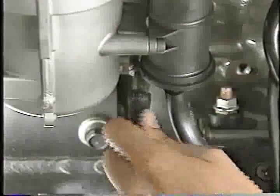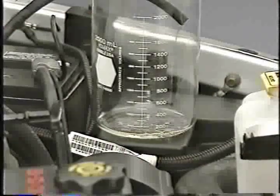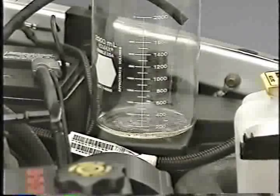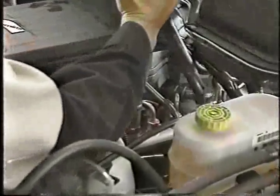This hose should be routed to a graduated cylinder. With the test equipment in place, start the engine and let it idle for one minute. If flow is less than 180 milliliters per minute, this part of the fuel injection system is operating properly. If the amount exceeds this, you may have a leak between the high pressure connector tubes and the injectors. You can eliminate these as a cause by shutting off the engine, removing the high pressure lines, and re-torquing the connector nuts. Be sure to use the torque specs in the service information.